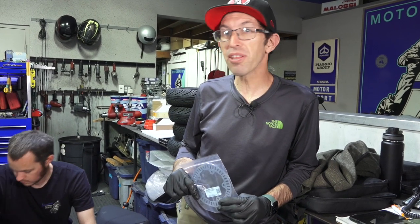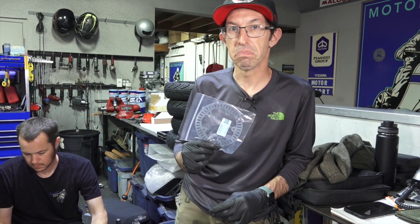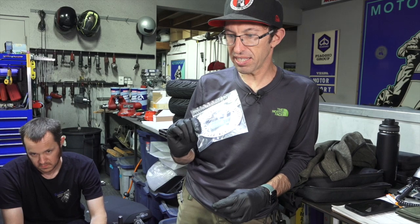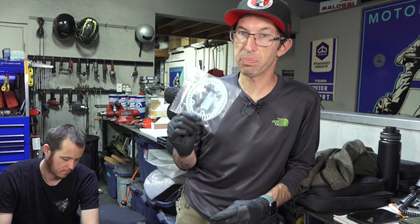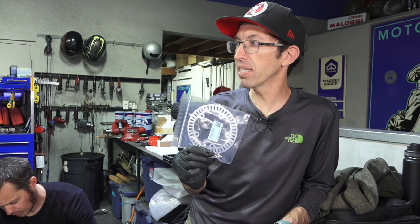Top speed is slower. How is it limited? Not by the RPMs, but by the detected wheel speed. Fortunately there's a solution for you — part number GTS-HPE-SPEED. The rear wheel speed sensor is what the computer uses to base the top speed limit on these scooters.